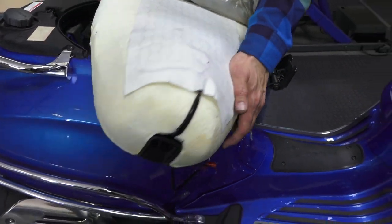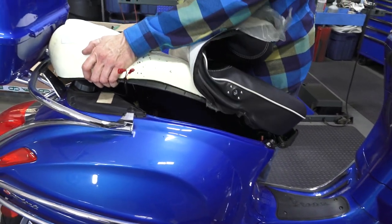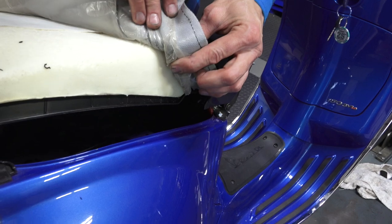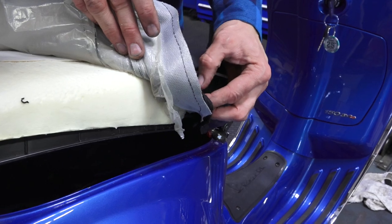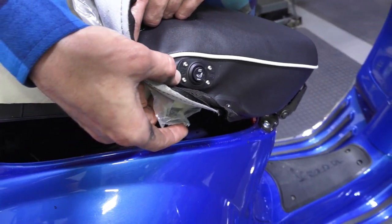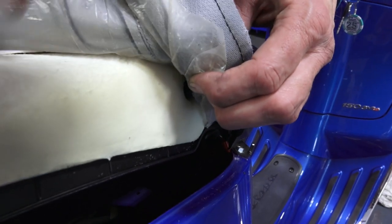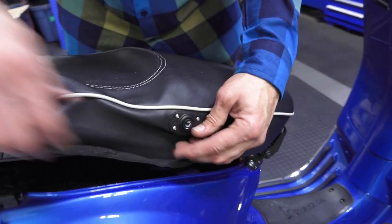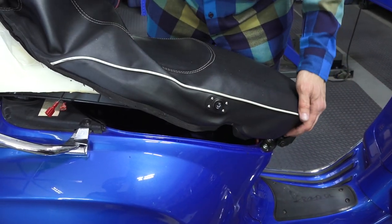There's a single wire going up in the front — I'll show you how the wiring works. If I pull this back, there's a hole that I carved into the foam. This little escutcheon or bezel that goes around the switch has another plastic backer that's been bolted, so it sandwiches between the material. I carved a hole in the foam so it goes right into the seat. When we get it all tight, you won't feel it — it still has foam all the way around the switch, and that's the way it's designed.